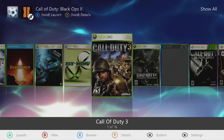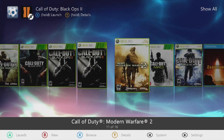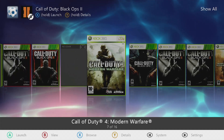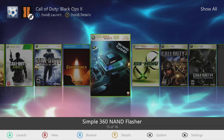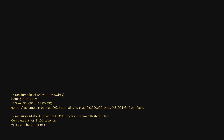We are back and I did put all my games from my RGH onto my hard drive with my retail Xbox right here. As you can see you can just select whatever one you'd like to play. I do have Black Ops 2 with DLC 5. Before we do anything else, I'm going to run Simple 360 NAND Flasher to dump my NAND - that is really important to do. Click X and it will produce a BIN file. Put that onto your computer - if anything happens to your Xbox you can re-flash your NAND and that's going to be a lifesaver.